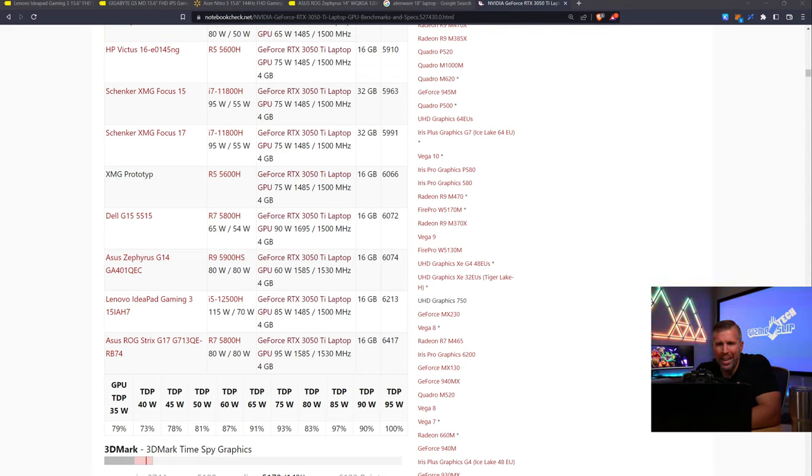Our CPU temperatures are peaking hard right now at 98 degrees, which is obviously not ideal, but in my opinion, it is probably still safe for the laptop. It's just not ideal if you're going to be running CPU-heavy stuff all the time, like video rendering. But it's unlikely to damage it because laptops are designed to function within this temperature range. That's the truth, but it does suck running at this high of a temperature. It's concerning. Not that it's going to be destroyed instantly or have a short lifespan, I don't think. Typically, your ideal temperature range under a heavy CPU load would be under 90.